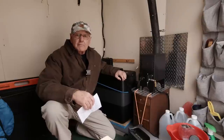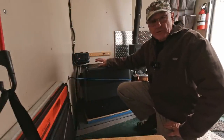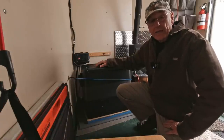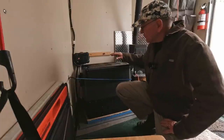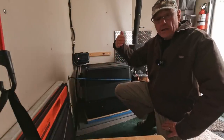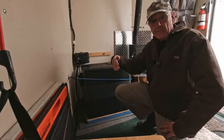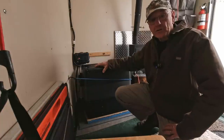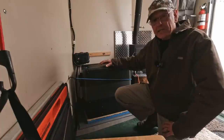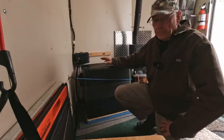So just remember that. Now, some people have mentioned noise problems, not with this refrigerator in particular, but just these 12-volt compressor refrigerators. What I've experienced is a noisy basket inside that starts buzzing. Sometimes the baskets, like this one has a basket divider, can buzz when the compressor's running, and all you need to do is move something inside and it'll stop that. Most of the refrigerator noise that I've experienced has been because of something buzzing on the inside. It just needs to be repositioned a little bit.